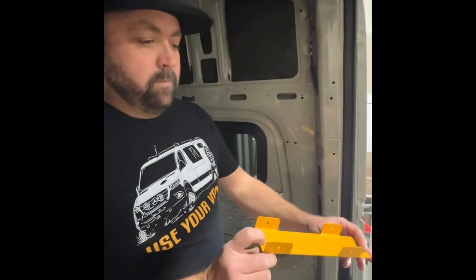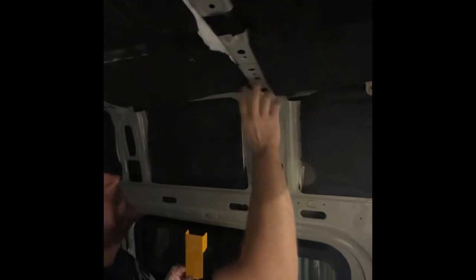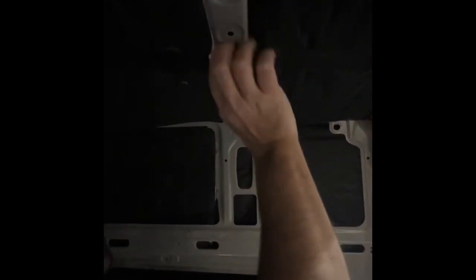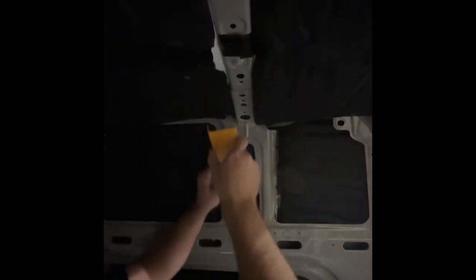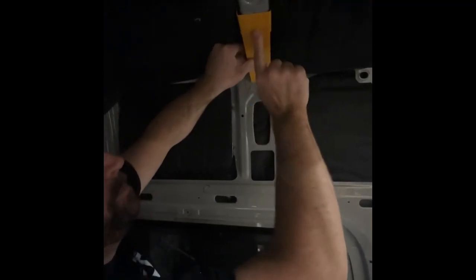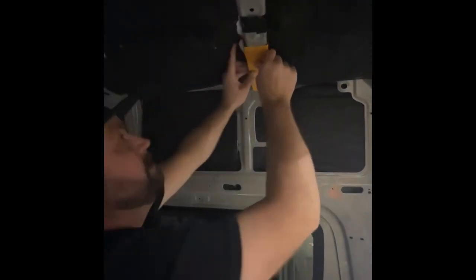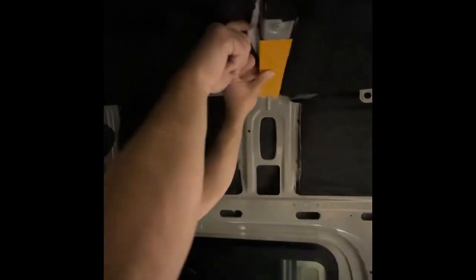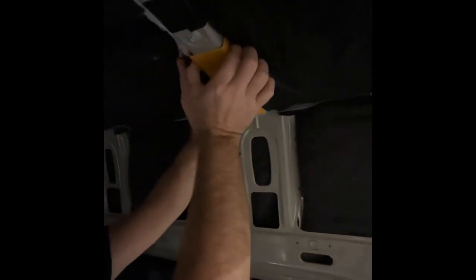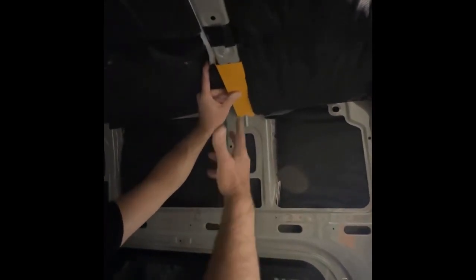This is the upper bracket that attaches to the roof beam of the van. When you pull the headliner, you'll notice a whole series of factory holes in the roof beam — these are there for the headliner to attach to. We've made a cover plate that goes on here to give you all new steel so that when you drill up into the roof beam from our cabinet, you're not mistakenly hitting a factory hole. Place these in position, and from the side you'll see four ears — two on each side. Pre-drill in all four spots and attach these with 3/16-inch rivets. Do that in two spots after your spacers, and then we'll be ready to put things back together and install the cabinet.